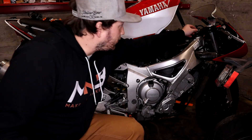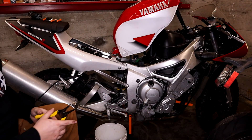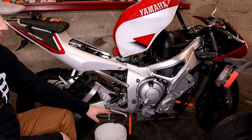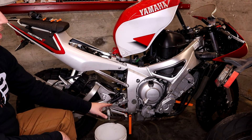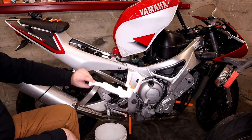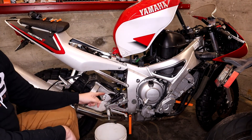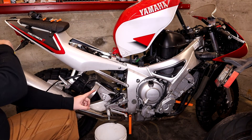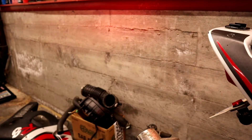We're going to go flip this thing on here. I have reassembled the rear brake assembly partially — mostly just so the plunger will move and not the whole plastic rear set, which was just flexing as opposed to the actual plunger moving. If the plunger moves and we get enough pressure, we should get a brake light lighting up. And that's a success!